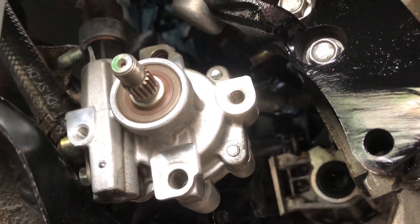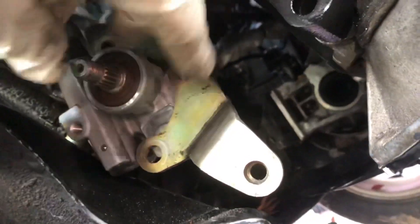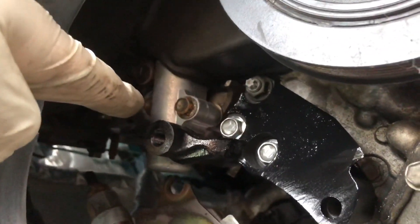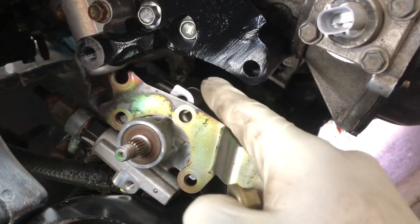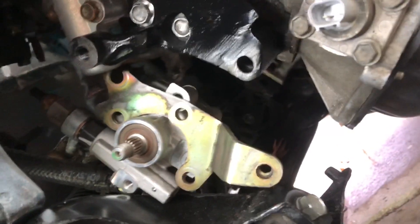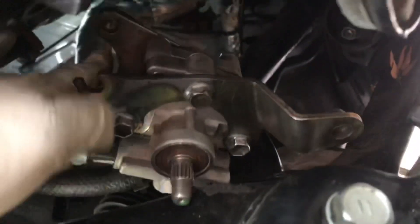So let's go ahead and finish installing the brackets on the 1MZ power steering pump. We're going to put this bracket, which has this angle out to go over the timing belt tensioner. And then the back bracket goes right behind it, because it has the nuts on the other end holding the bolts that we're going to feed in. If you don't have the axle installed, there's plenty of space to get to the bolts to hold the power steering pump bracket.